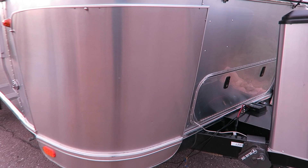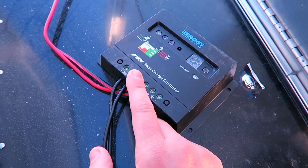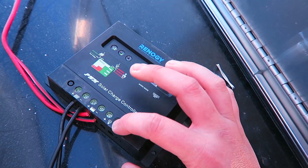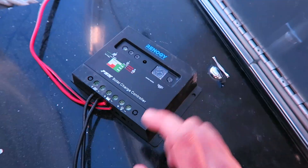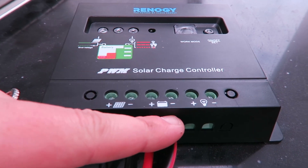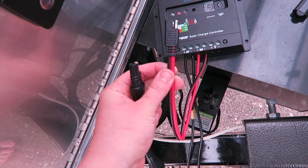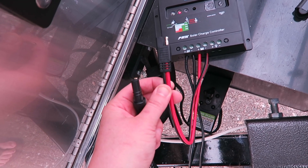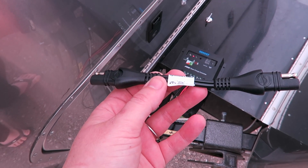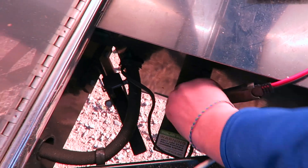That wire runs up to the charge controller right here. You can see the wires from the positive and negative are running into the charge controller where it shows the panel — there's a hole you slip the bare wire through and then tighten up the Phillips head screw. This is the part I had to purchase separately — make sure you have the right gauge. This is the positive and negative that run to the Zamp plug-in. The cable comes down and has an SAE connection. Most SAEs are reverse polarity from the Zamp, so we have an attachment that changes the polarity — it looks like the exact same tip but it's a reverse polarity SAE-to-SAE adapter. Just plug it in and it's good to go.